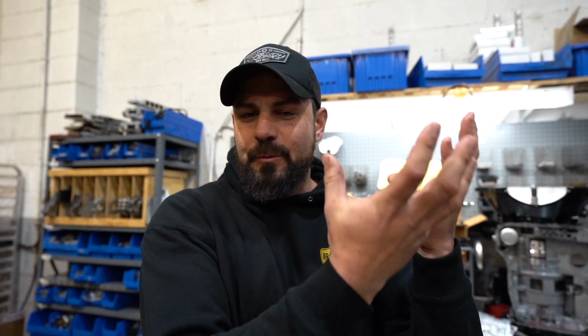Guys, so like I mentioned, we're using our 2015 truck, and for most people that do or don't know, completely bone stock transmission, so perfect candidate for what we're about to show you. Now, most people will associate Ram trucks with the Cummins engine, which will run and last for a very, very long time. Now, the transmission behind it as a whole, not a bad unit at all, but the major pinpoint issue that we are gonna be fixing and talking about, and what we removed from the truck, again, very easy for you guys to tackle yourself, is the valve body in the truck. That is the major Achilles heel of this entire truck, so to say.